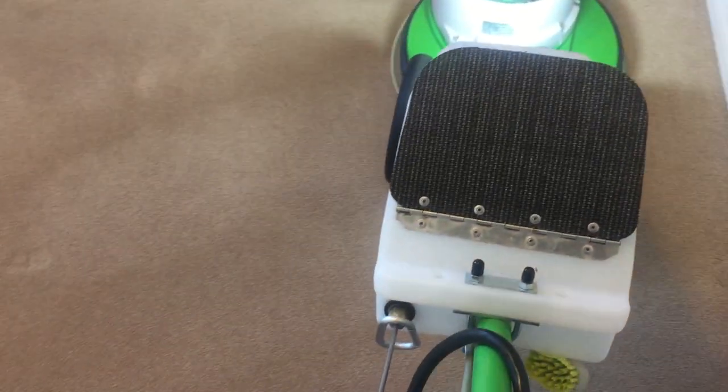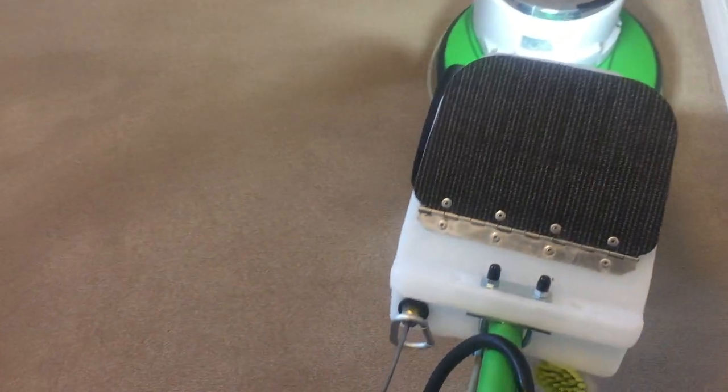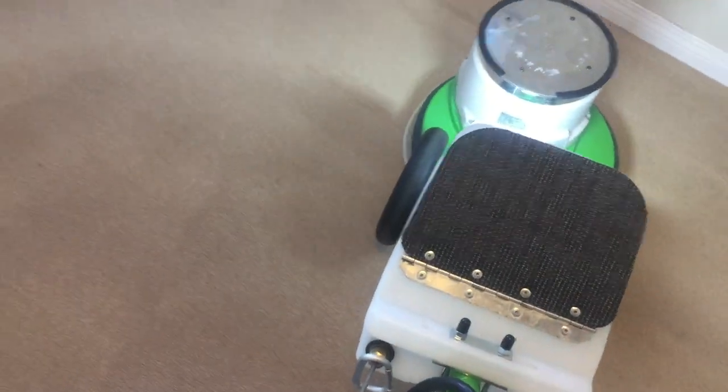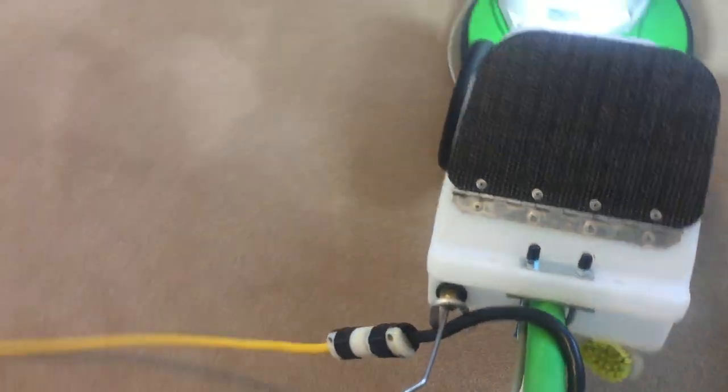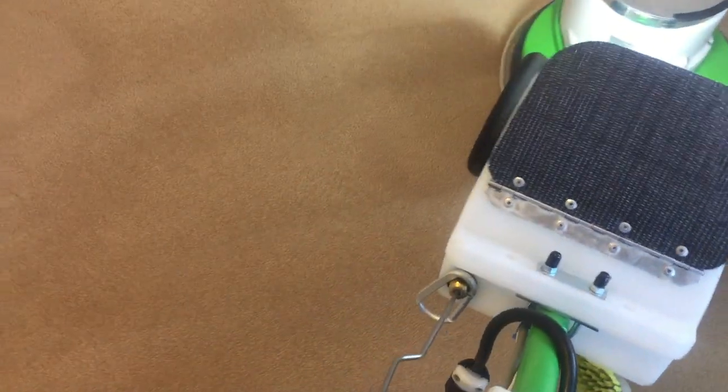I had a motor actually. It developed a problem as well, which I had rebuilt, which is actually the motor that's in this one. The cooling port vent, whatever, that's actually underneath that plate on the top, had clogged up, and this is way back from my first machine, and I never thought to pull the motor cap off and look at it from time to time. Because what happened is it picks up carpet fiber, and eventually it clogged up the intake for the cooling fan.